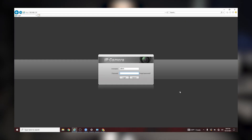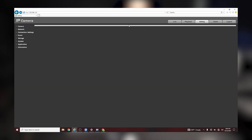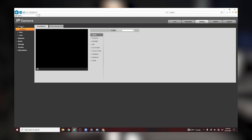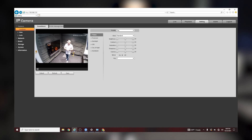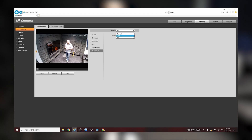You're going to go to the web browser and put in your credentials to log in. The default user is admin and whatever password you set. Once you log in, click Settings at the top. Then you're going to be on the camera condition settings. Towards the right-hand side you're going to see Illumination as an option, and in there instead of setting it to auto, you can switch it to off or manual so you can manually adjust it.